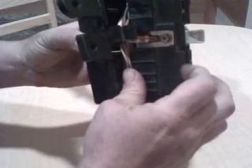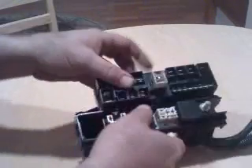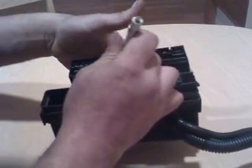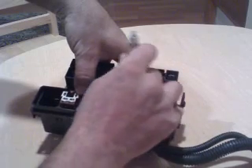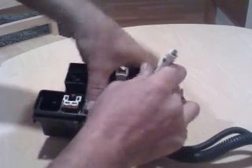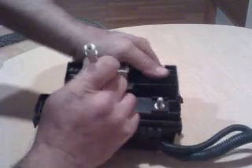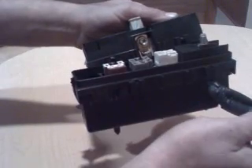On the other side there are two small clips in here that you just need to pry, and the whole fuse box will lift up. It pops out so you can get your other bolt — one's an eight millimeter, one's a ten millimeter.